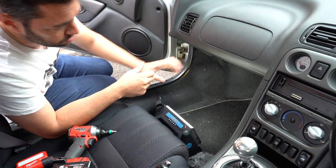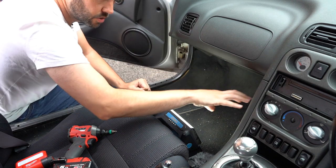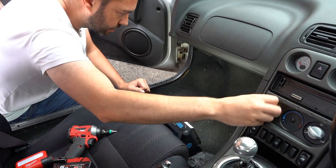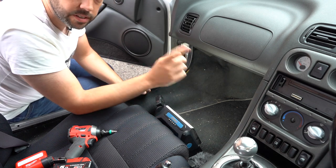The first thing I need to do is remove this glove box, because behind the centre console is a small almost-like resistor pack - a few resistors that control each of the blower settings. I can't get at that without removing the glove box, so that's first.